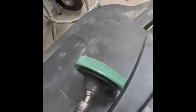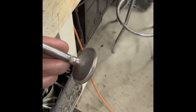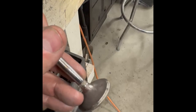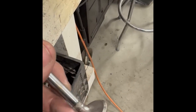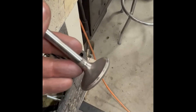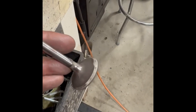I clean them up with this 3M pad. Some people say it's too rough, but I've never had an issue — it's just a real light hit with it. You want to clean up the stem right in here too, because you don't know if it's going to come up or go down further, and you don't want that old carbon catching up in that stem and guide.